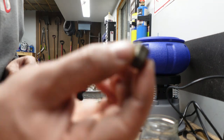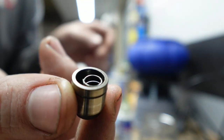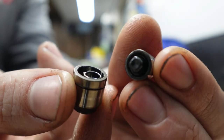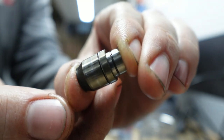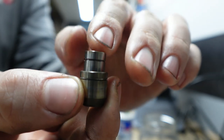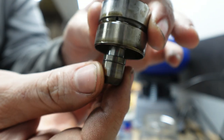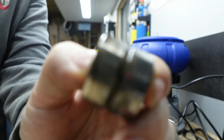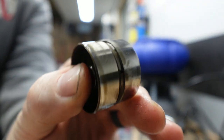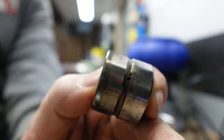Reassembly is pretty easy. Take the bottom cup, drop the spring in — it kind of just falls right in there. Then you take the plunger with the nubby end; that seats on the spring. You know they're aligned right when you can squish it. This doesn't really seat firmly; it's just barely in there, so try to keep it vertical. Then that whole assembly will go into the hole in the lifter body — kind of blind, but get it up into the slot. Push it together and it'll pop together. You know you have it right when you can literally squish it and it'll feel like a spring. That's the pre-hydraulic part of it.